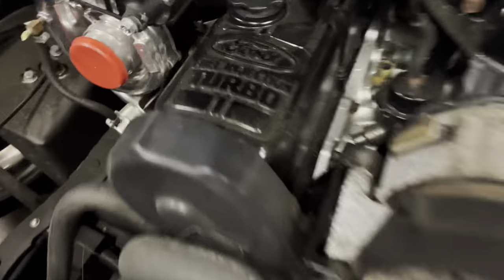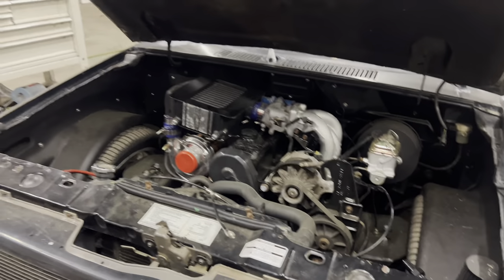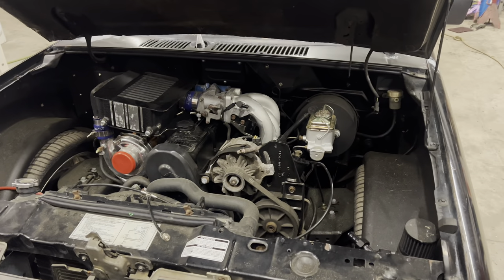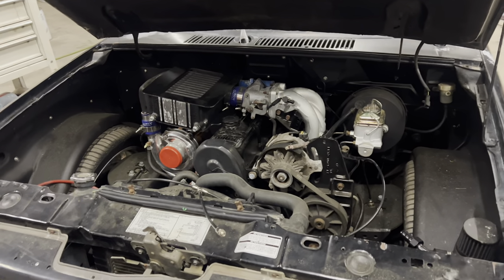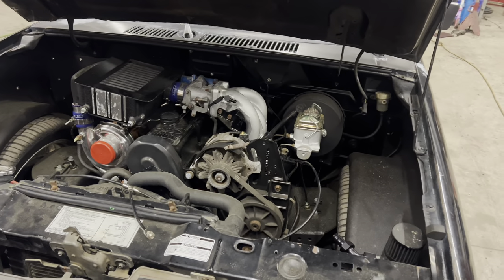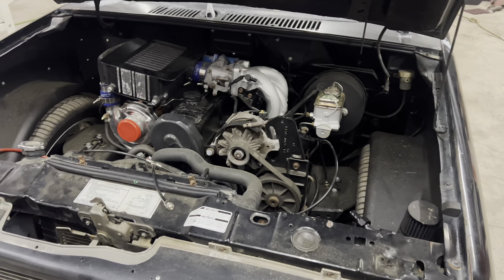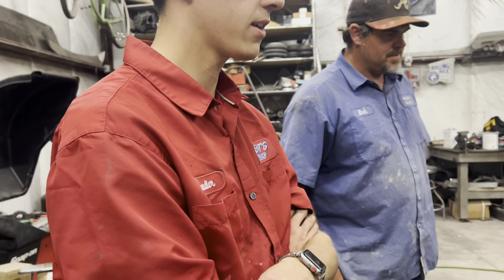This thing has got a 2.3 fuel-injected turbo motor out of an '88 Thunderbird. It's fuel injected, it's got a bigger turbo, an under-hood mount intercooler, and bigger injectors - 80-pound injectors, which is massive for a four-cylinder. When Chandler looked at it at Justin's house, the motor was halfway taken apart. Justin kind of threw it together so he'd know how everything went but didn't put any gaskets in it. We're fixing to tear it down and put in intake gaskets, exhaust manifold gaskets, turbo gaskets, new injectors, and a valve cover gasket.